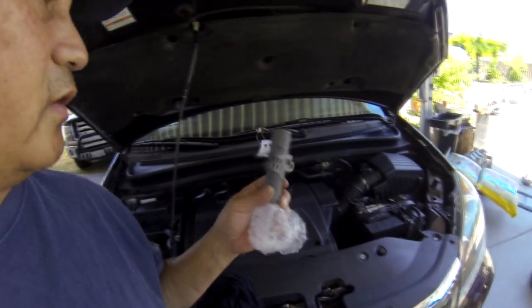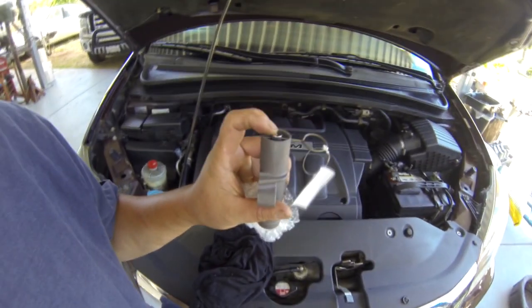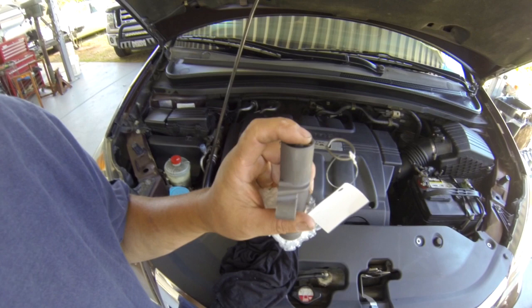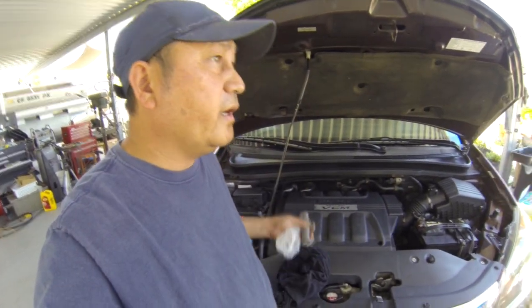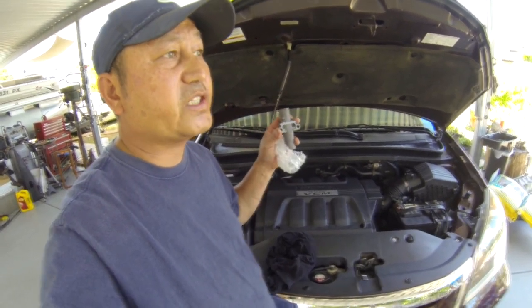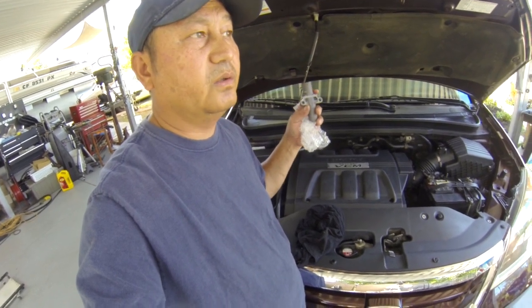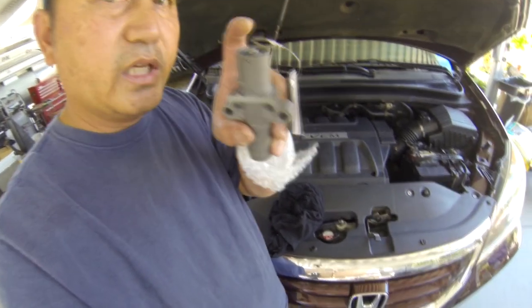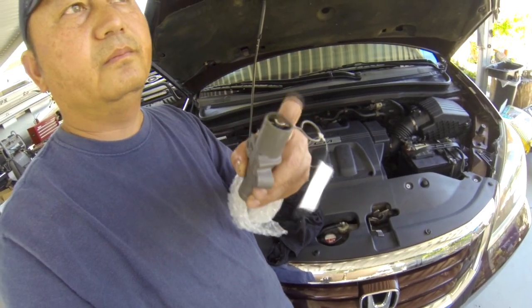in that case, let me show you this little boy here. Okay, the tapping sound you're having is this right here, the high pitch knocking right there. And now you can hear that the timing belt is flapping. And when you step on the gas and you hear a high pitch sound like a crankshaft, or like a bearing shaft, or anything like that knocking, it's because this thing here is tapping with the tensioner wheel bearing. So that's why you're hearing that noise.